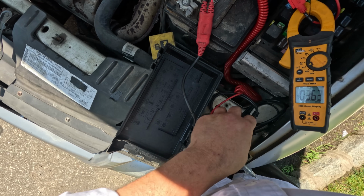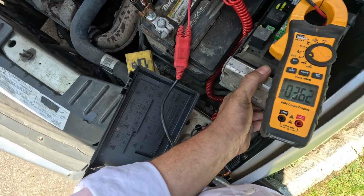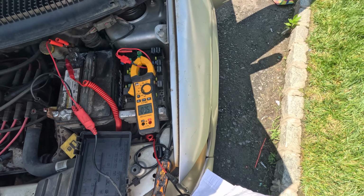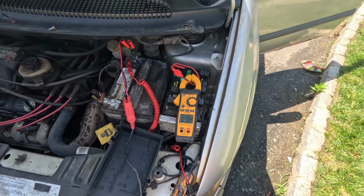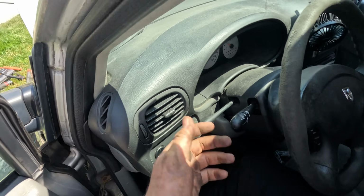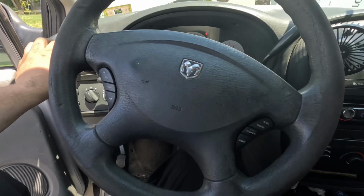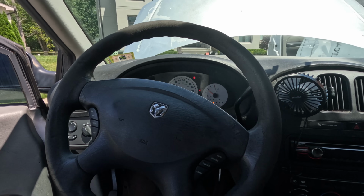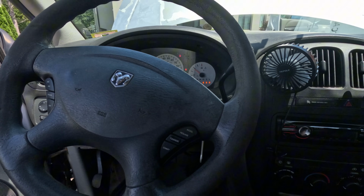Let me shake the box because there was definitely a short in there before. 3.6 amps. Maybe it's only on the turn on. Yeah, it's definitely getting cold. I don't know why it blew the fuse. It's probably going to blow it again. I'll tell him if it blows again, he has to look at it more. Wasn't really charging for this extra diagnosis, so I'm not getting too deep into it. But right now the AC is working.